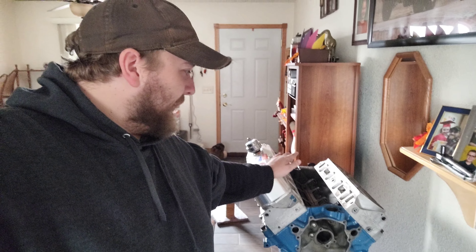Right now I'm just kind of looking to see, with the heads mounted on the block, how does the intake line up? Is there a gap on the top and nothing on the bottom? Because when you're dealing with heads that have been milled and intakes that are old and possibly had work done, sometimes this geometry does not line up. It will actually either want to spread the heads apart as you're bolting it down, or the angles will be off so it won't seal.